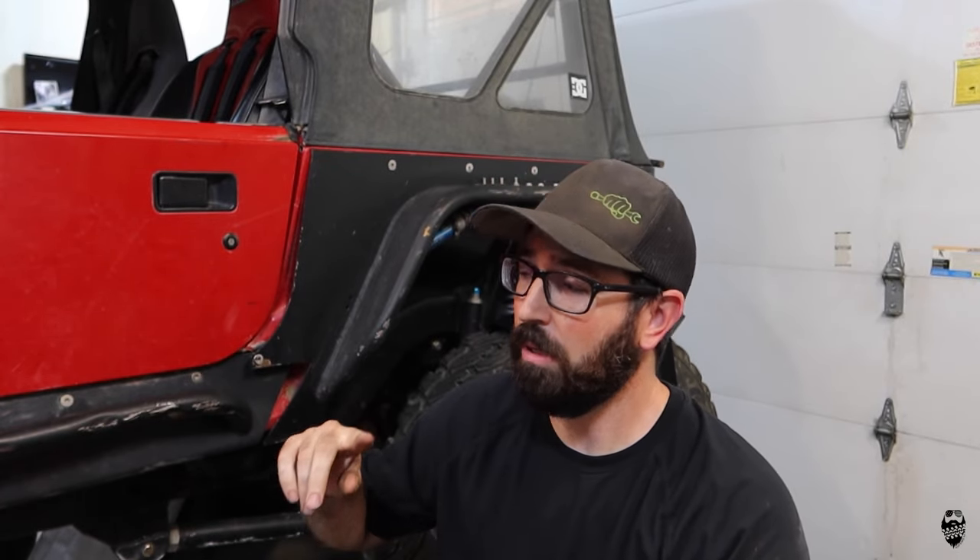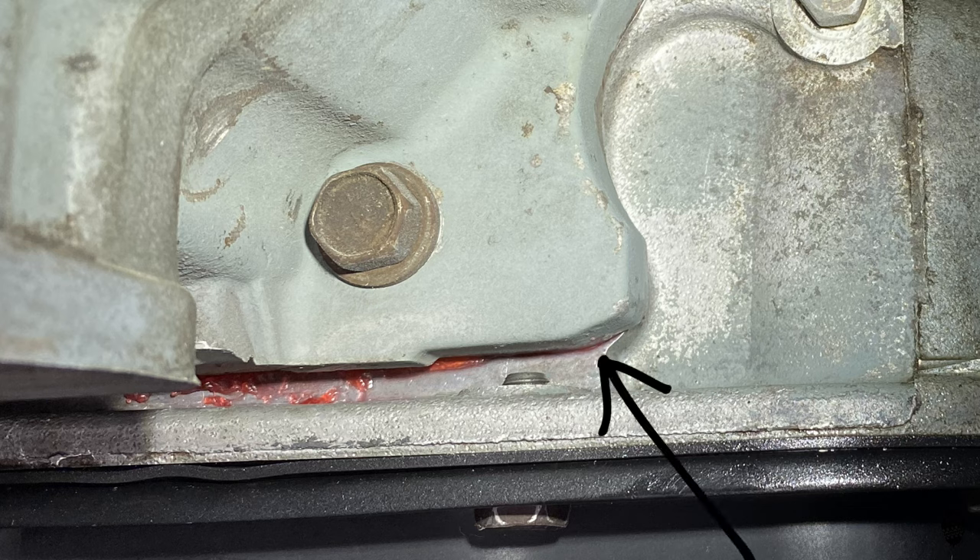It is the next day. I did run it because I looked last night and I didn't see anything. Today I can definitely see a tiny, tiny little bit. I can't really show you with the camera so I took a picture of it to get a lot closer up in better detail. You can see right here where the two case halves meet — it is leaking in the bottom right-hand corner, just the tiniest little bit. That little seep right there over time comes down and slowly drips, and that makes sense of where the drips are coming from.